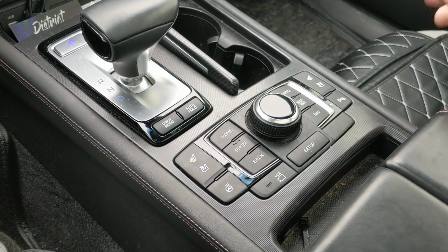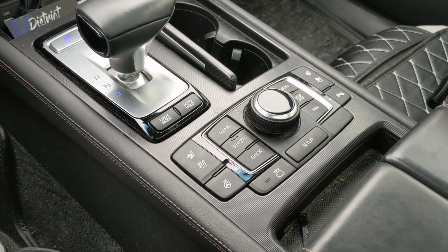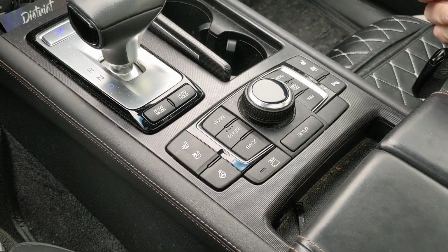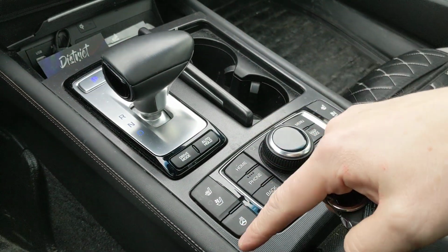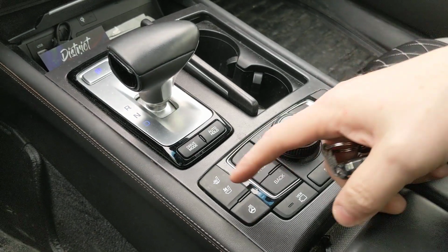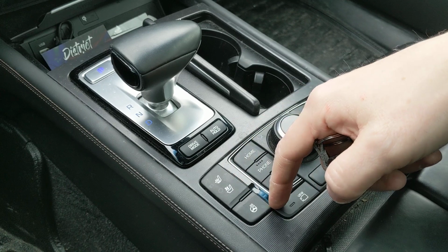The reason we had to do that is there's a limited number of programmable output controls that we have on the DC3. In this particular instance, because we were hooking up so many heated accessories, i.e. the rear defrost, the heated seats times two, and the steering wheel, we didn't have enough POCs to keep these all individual. So we had to combine one of the programmable output controls to control heated seats and steering wheel.